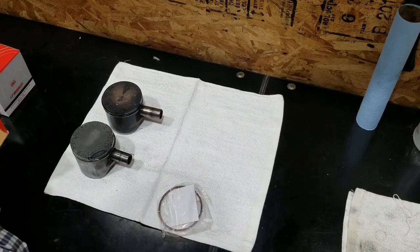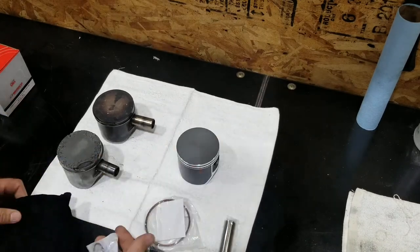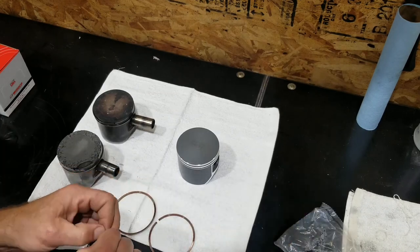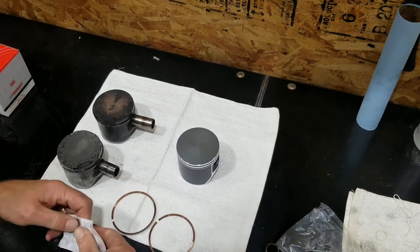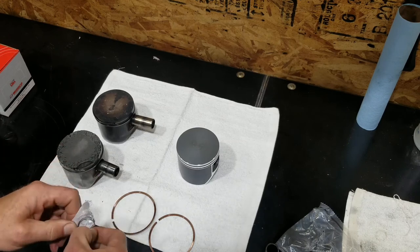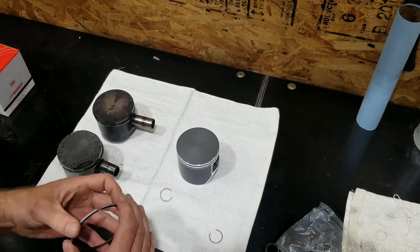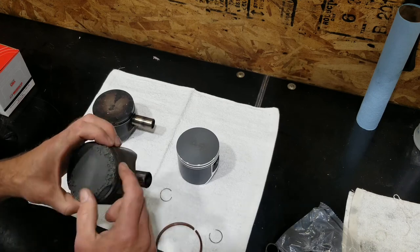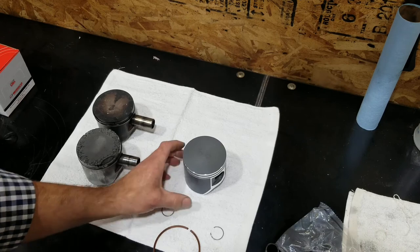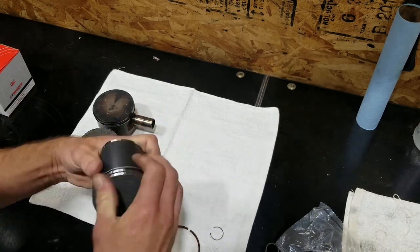In a multi-cylinder engine, even with just two cylinders, a failed piston is probably first noticed by poor power or poor idle. You may start the engine and it may be a little fussy to start. You may have to give it some throttle, and sustain some throttle, to keep it running. And you may find that it won't reach top RPM. A snowmobile engine should run in the neighborhood of 8,000 RPM. If you're only getting 7,500, maybe 7,800 RPM, that can be a symptom. It's not the only thing that can cause that issue, though.